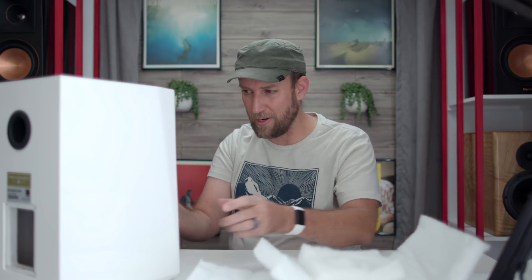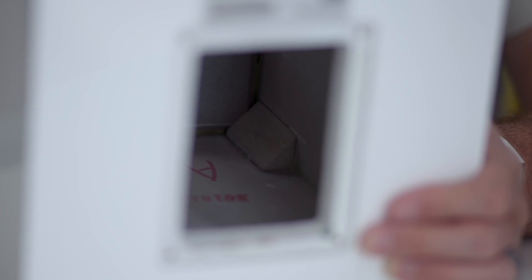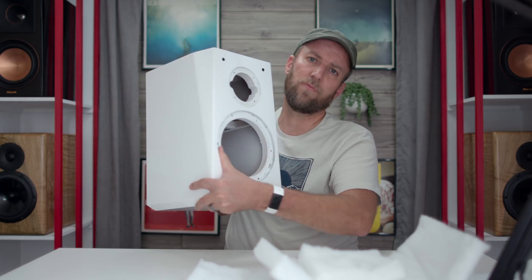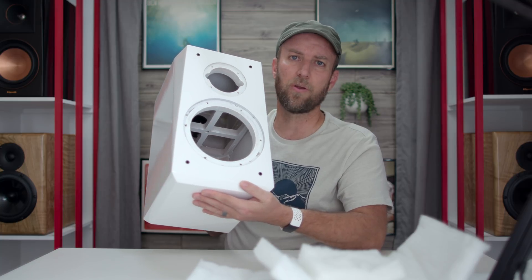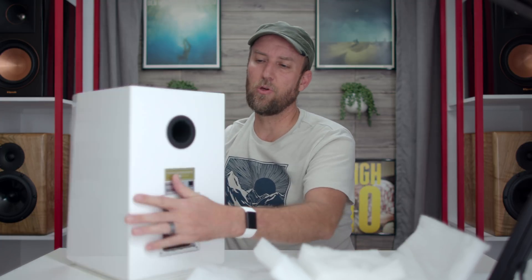With the polyfill sheets out, I'm noticing small corner braces. In the back there are four and in the front another four — a total of eight braces just in the bottom section alone. There are smaller braces as well. There's also a cross-section brace right above the woofer. In the back we have a port, and notably it has a rubber-like texture — not your typical cheap-looking plastic port.